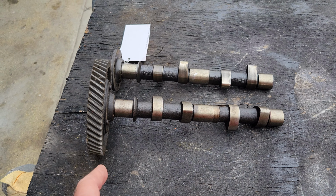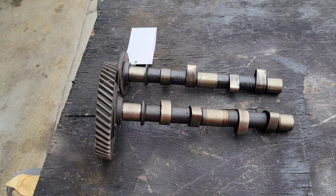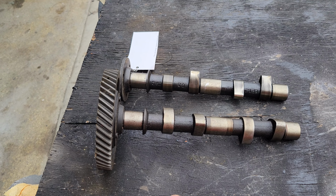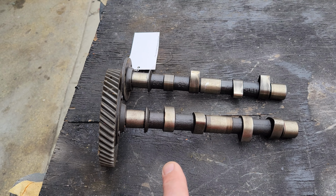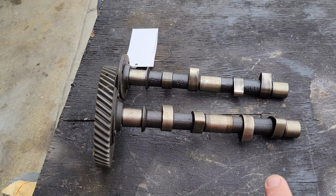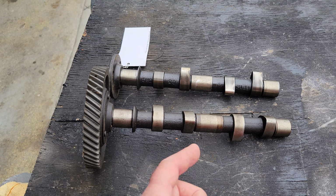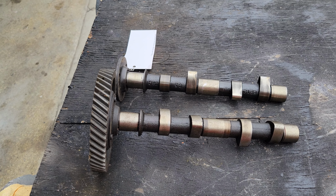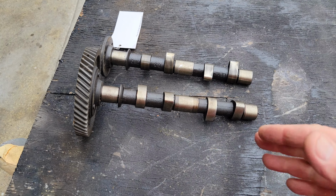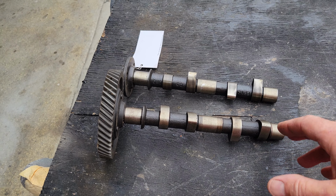So anyway, the biggest performance upgrade you can do to a Volkswagen without spending a lot of money, and people always go for cylinders, they go to pistons and cylinders, they go for a bigger engine. Really, the biggest bang for your buck is right here: camshaft and increasing the compression. A camshaft and taking the compression up to 8.25 to 1 can make a huge difference in the power of your Volkswagen. So we're going to talk about the smaller size engines up to maybe a small 2-liter.